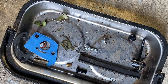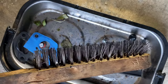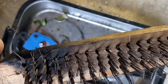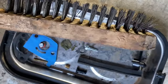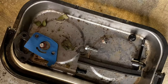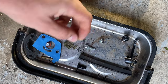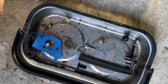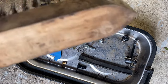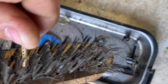Here are the parts laid out. The best and cheapest way I found to clean jets is to get a wire brush from like a grill — that's what this really works good for cleaning out the jets — and also a can of brake parts cleaner or carburetor cleaner. Let's start with the emulsion tube. What I like to do is before I clean the inside, just kind of scrape it to get all the grime off so it doesn't get stuck up in there.